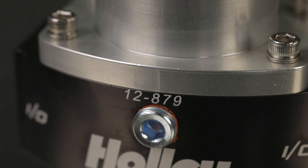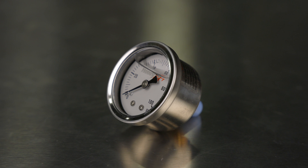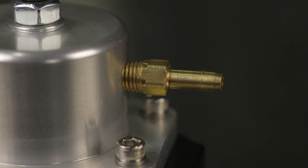The second included pressure spring will allow you to increase the pressure up to 65 PSI for EFI systems. So in short, you get accurate fuel pressure that remains constant regardless of load. Since the pump operates just enough to maintain pressure, this equates to longer pump life. Many models are available with various port openings. A 1/8th MPT gauge port allows you to use a mechanical fuel pressure gauge for easy fuel pressure adjustments. A 1-to-1 boost reference port is also built in for future turbo or supercharged applications.